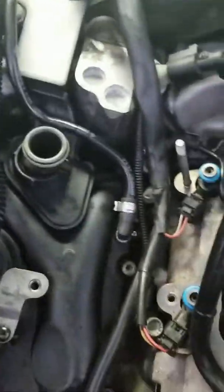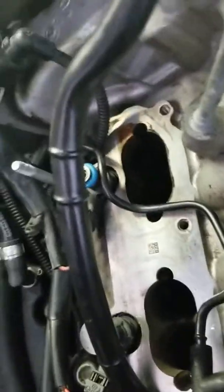Okay, so, you see those two or four valves, there's two in each of those orifices, are still varnished. So what I'm gonna do, I gotta rotate the motor. I'm gonna put a socket around my crank and turn it till I get those to seal, to close up, and then I'll finish off cleaning those before I totally reassemble.